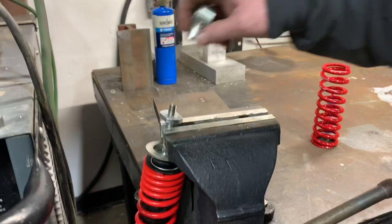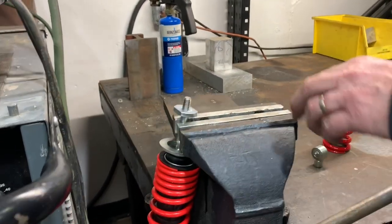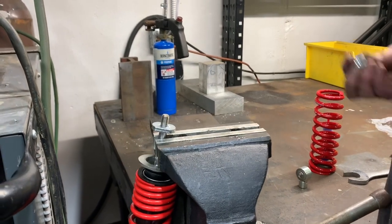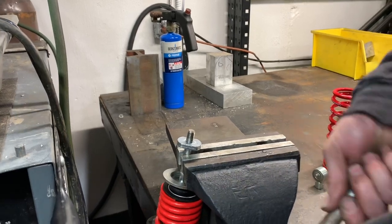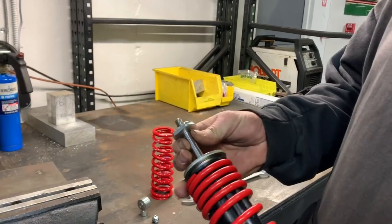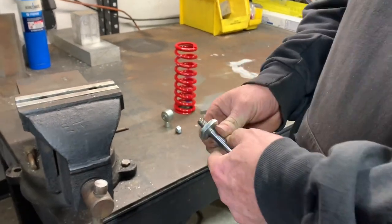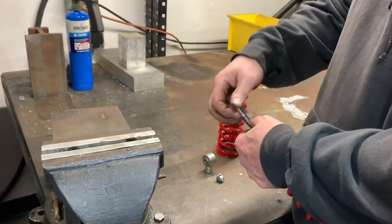Once you get the clevis loose, you have to get the jam nut back off of the chrome shaft. If you have soft jaw vice grips you can put it in there and it'll come off. Or you can take two 10x1.25 nuts and screw them on there and break it loose like that. I've seen guys grab the shaft down here with vice grips — it's under the bottoming rubber — probably okay, but I'd be scared to do that. Basically, screw this jam nut off of here.